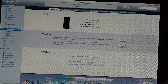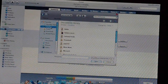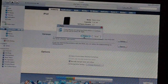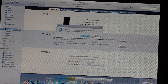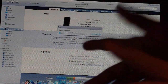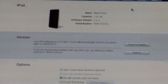You're going to click Shift and Restore in iTunes and your file browser will pop up. Go ahead and select your firmware — mine is on my desktop. Double-click on it. It says iTunes will erase and restore your iPod to iPhone 3.1.3 software and will verify the restore with Apple. Just click Restore. It will take a bit of time. As you can see it now says 3.1.3, so it did finish restoring.